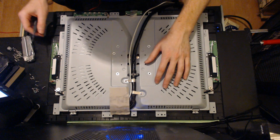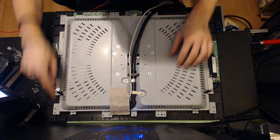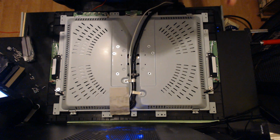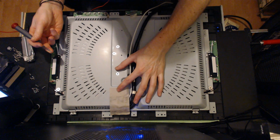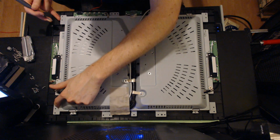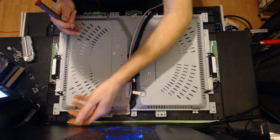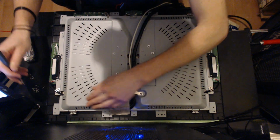with these bolts, and I did this the first time, you'll notice that there's 2 holes on every one of these tabs. And only one of those holes is the right one for this metal bracket. The other hole is for the plastic shell. And the way to discern which hole you use for this metal bracket is there's a stamped ring around the hole that you are going to put the screw into the metal bracket, which is helpful. You just have to remember that that's the designation for the metal bracket, is the ring that's stamped on the outside of the appropriate hole. So that's how you do that.